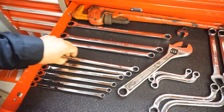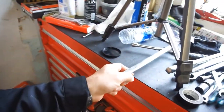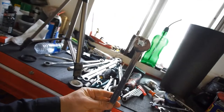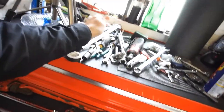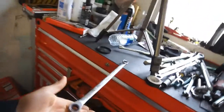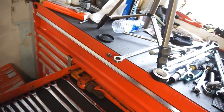That is my tool review — Thursday's Tool Review. I did use them for the truck to swap all the exhaust back on: 5/8ths, 15, 18, and a 21. The 21 I was using from the Pittsburgh wrenches, which work, but they're really flexible and really sharp in the hand. Whereas these GearWrench have a little more girth. I love this set of double box-end ratcheting wrenches. They're awesome. I definitely recommend these to anybody that has to get in tight areas.